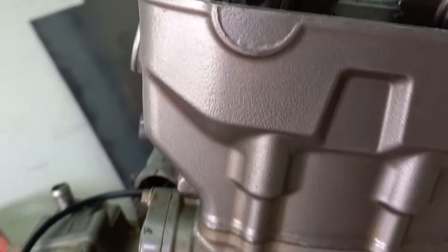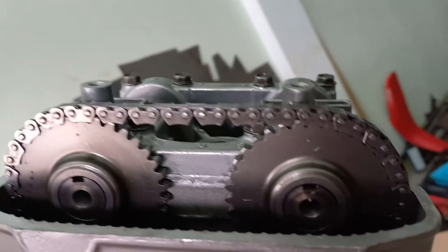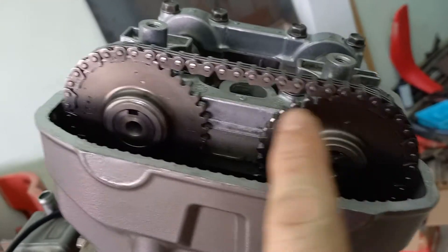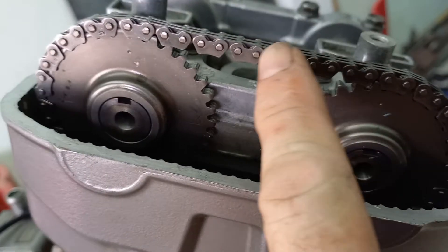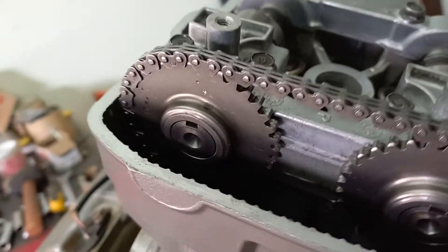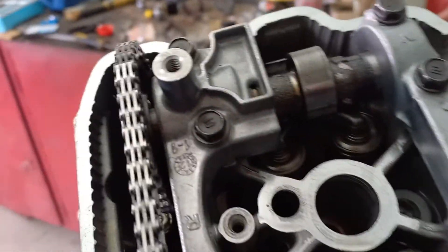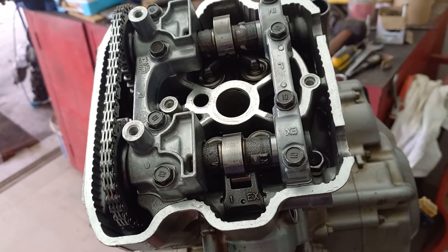Two revolutions later and I am on my inlet marks there — my dots are facing up and I've still got 15 pins between the two dots. That pretty much suggests we're all good on the valve timing, plus the engine turned over with nothing banging — no bang, snap, wallop or whatever. So let's get the feeler blades out and see what my new clearances are.